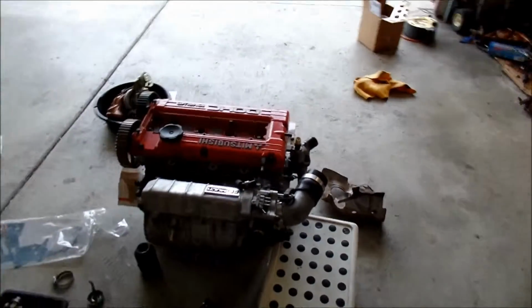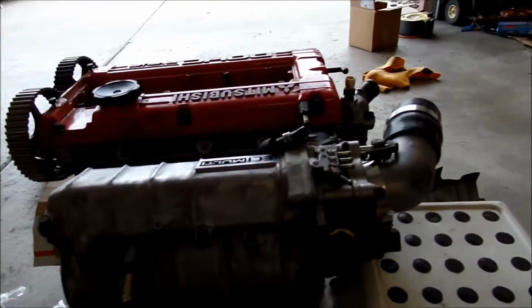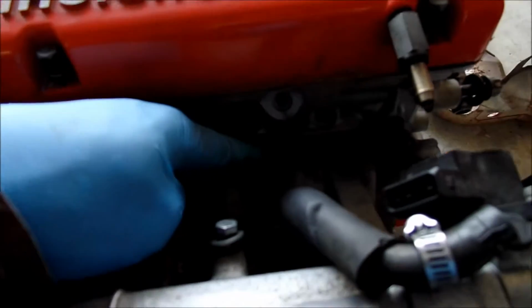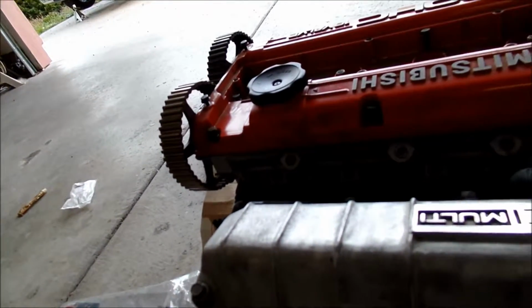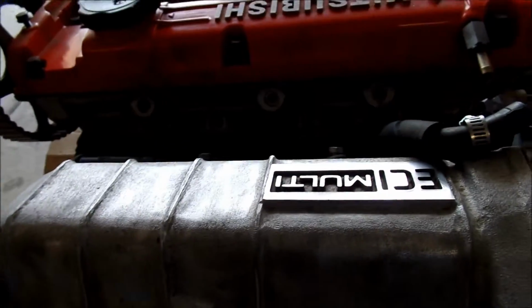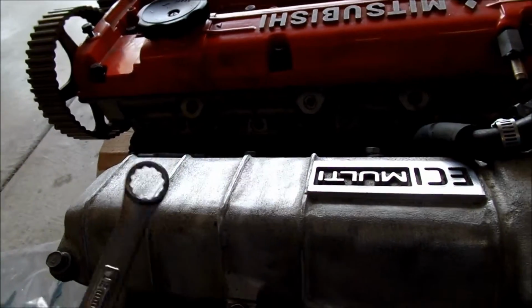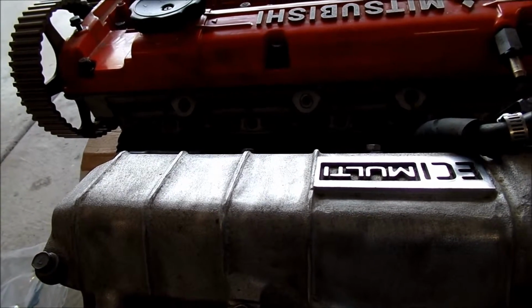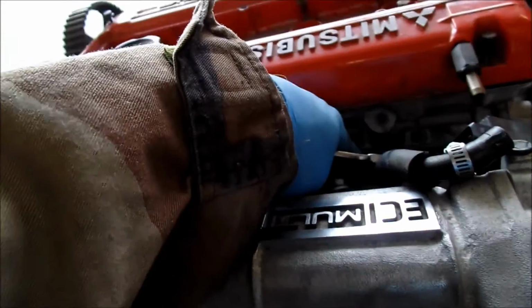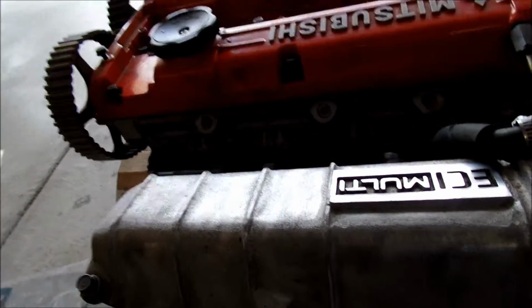Okay, well, like I said, it was a bitch to take this manifold out, but it was a bitch to install it, too. I couldn't torque it at all, pretty much. The only ones I was able to torque were these two with the little baby wrench. The rest of them, there's too much stuff in the way, you know? My half-inch torque wrench won't fit in here, won't fit in here, won't fit in there. So what I had to resort to was, I torque these ones. I would turn these like two turns, and I would use the wrench, and then I'd remember how much I turned that one. So I turn it like two normally, like 1/8, so like a quarter. And I would move on to the next one. So these ones are torqued, I know for sure. And then the rest, I just snugged them with the wrench, however much I thought this moved. Well, hopefully that'll work. I think it should be fine.